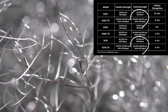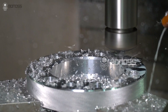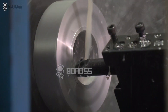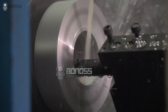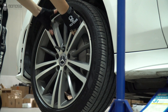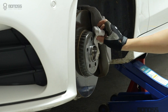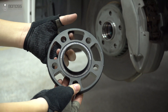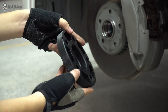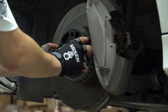The hardness of 7075T6 is about 1.5 times that of 6061T6. It's applied extensively to aerospace, aircraft building, and boat construction. The strength of aluminum alloy 6061T6 wheel spacers is totally strong enough for daily driving. However, if you like drifting, you better choose aluminum alloy 7075T6 wheel spacers.